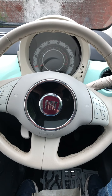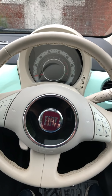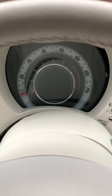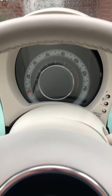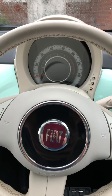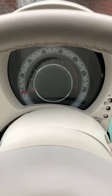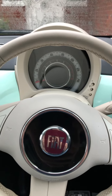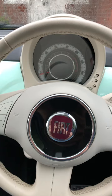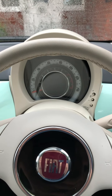Hello, I had a problem with my Fiat 500 liquid crystal display — the bit in the middle. When I came to charge the battery, I didn't realise that you have to disconnect the battery status plug on the negative terminal. I didn't do that, charged it, and it actually blew that display, which was a nightmare. It cost me £250 to get it repaired, but the biggest issue I was concerned with was actually getting it out, because I couldn't really find anything on the internet or YouTube about how to do that.